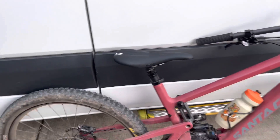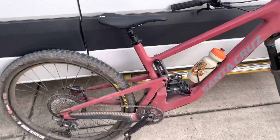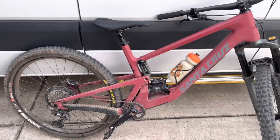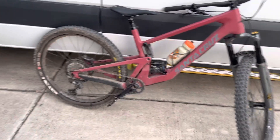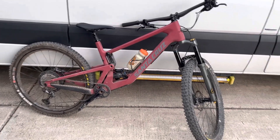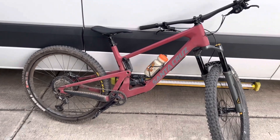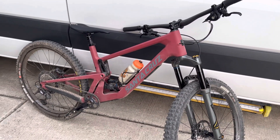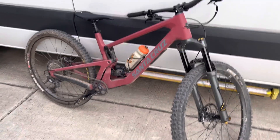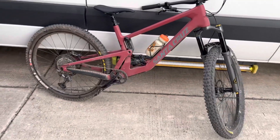Obviously when you raise your front end, your seat angle is going to change. I went a little more nosed down than I normally would, just because with the seat angle slacking out I figured put yourself in a more aggressive climbing position. I'm not too bent out of shape about the seat angle being a little slacker — you can always adjust your body on the saddle and use body english to keep your tire from spinning out and your front end on the ground. A lot of companies are trying to get the geometry optimal so the bike does the work for you, but I don't think it's a big deal if your seat angle changes by a degree.